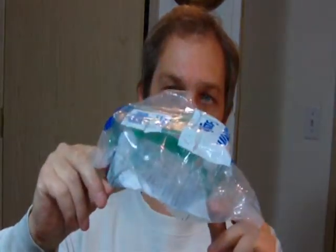First of all, you're going to want to have a good quality pair of safety glasses. These are shaded for outdoor use, but they come in all different styles. These are very inexpensive ones. This is a pair of goggles — still in the wrapper. You can buy them at a hardware store for just a few dollars. Insurance companies typically require a face shield to keep their premiums low. This is a typical face shield. It protects the technician in case the battery explodes. It's just good practice to work safely.